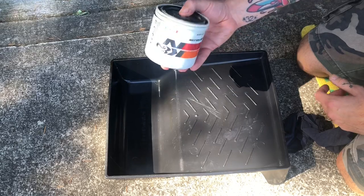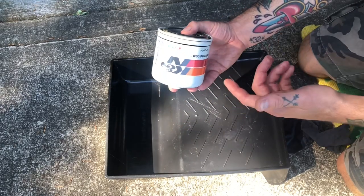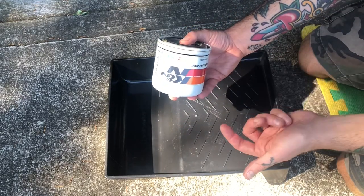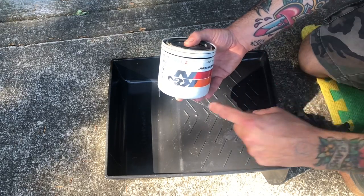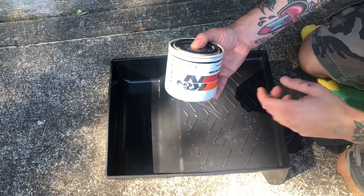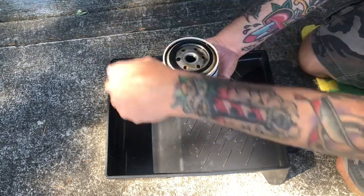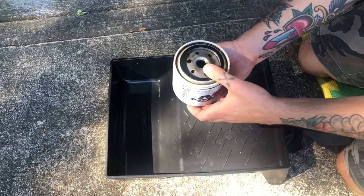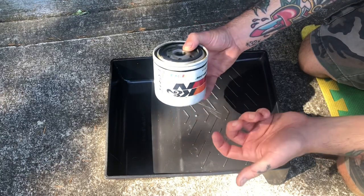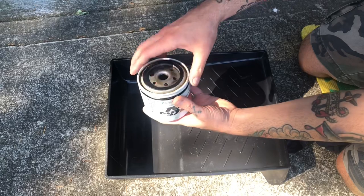Okay, so you've seen what's in the bottom of the pan - now let's go ahead and get into dissecting that oil filter. Here is our infamous oil filter - this is the same one that came off the car. This is a K&N Gold Series filter. They're really nice - Engine Masters just did a thing on these showing they have excellent flow and excellent catch capabilities, and they got a little additional thing in the bottom I'll show you too, which is a really nice little feature to help catch some extra debris. If you've never cut one of these things apart, you can use tin snips to do it, or you can use an oil filter cutter - that's what I did. I got mine from Summit, it worked really well. Don't use a hacksaw or something because you'll just add debris into the filter. Basically you just go around it, opens it like a can opener, and then you get to the dissection part.